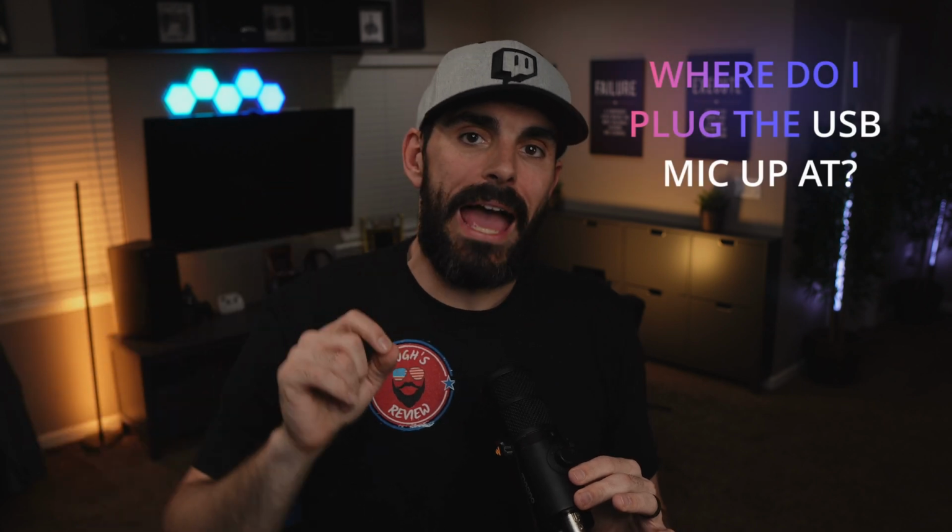So another common question I get, I literally popped back over here to do another quick Q&A because I totally forgot about this one: do you have to plug it into the Xbox for it to work, as in the USB for power? Again, you only need to put power to the mic. So anywhere, give it power. It doesn't matter if you're plugging it into a PC or a wall adapter, a USB, it doesn't matter. As long as it has power to the mic, you're good to go. You do not have to hook it up to the Xbox. So if you don't have any more Xbox ports, just plug it into the wall. As long as it has power somehow, it's going to pick up and you'll be good to go.